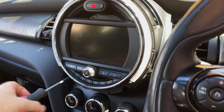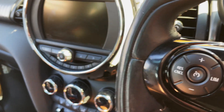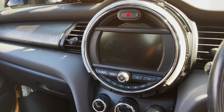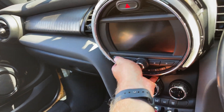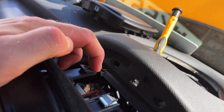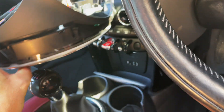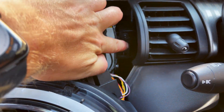This might feel scary, taking the dash apart, but honestly it's quite easy as long as you've got the right tools — the T20 bit, for example. Those two screws are out; next, because we've released that clip — the clip goes through this little hole at the back and that's why you're pushing your screwdriver down, flexing it down — you can pull this forward. You can see: those two screws out, and that is now your screen out.